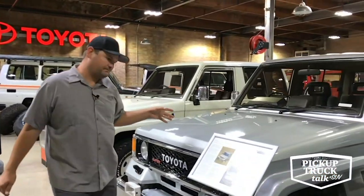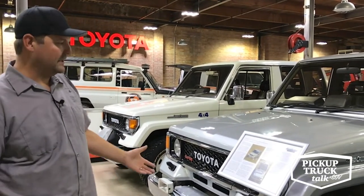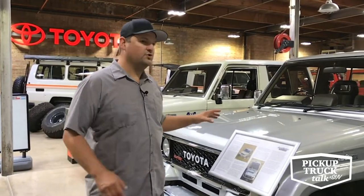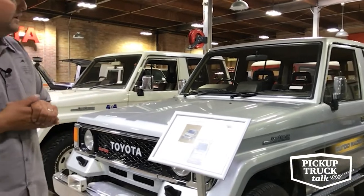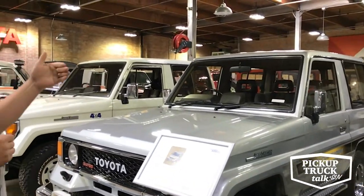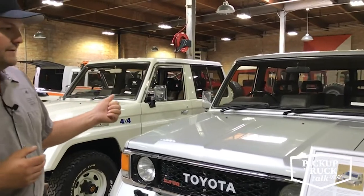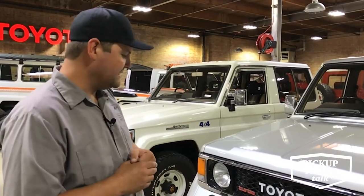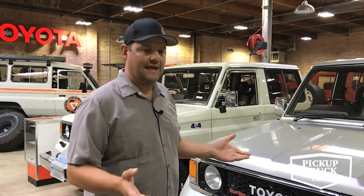This is an interesting break-off point — the light-duty Land Cruiser, also known as the Prado. This is really the start of two different directions the Land Cruiser went in the mid-'80s. It's got a lighter-duty drivetrain: smaller axles and a smaller motor. From the A-pillar back it's the same body, but from the A-pillar forward it has a different front end — a wide body versus a narrow body. The big differences are when you pop the hood: a smaller displacement four-cylinder motor, also available in gas. Instead of the traditional nine-and-a-half-inch differential front and rear, these have eight-inch axles — parallel to a US-spec 4Runner from the same vintage. That's called the Land Cruiser Prado, still made through current as a light-duty Land Cruiser.